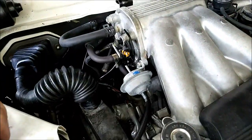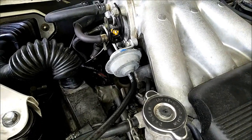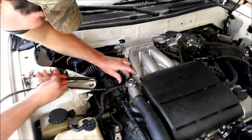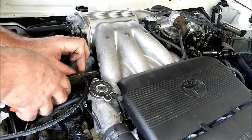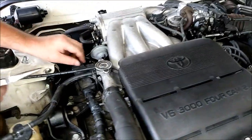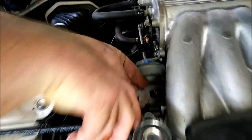There must be an adjustment screw right there. You guys probably have no idea whether this system is actually working on your vehicle or not, unless you get out, have a buddy watch under the hood, and rev the gas pedal up to about four or five thousand RPMs real quick to see if this thing opens. Or you can manually vacuum test it with a piece of vacuum hose — suck the hose and see if it works.